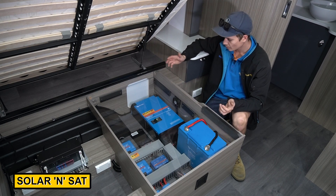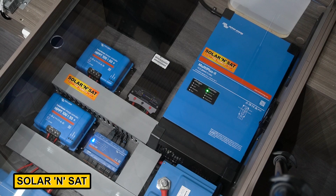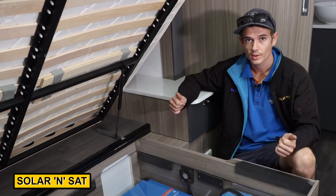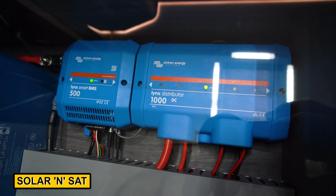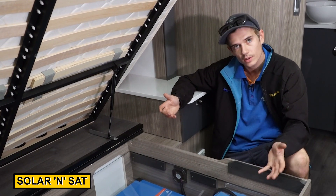With this one here it's really flowed perfectly. We've managed to fit the 3000 watt Victron inverter on this side with a fan above it, so it still has plenty of ventilation. We've got two 100-50 solar regulators to handle the solar on the roof. We've used a 50 amp Victron DC to DC buck boost that'll handle the charge from the vehicle's alternator all the way back to the caravan's battery. We've got a big 330 amp hour Victron lithium battery that can handle a massive discharge of 400 amps. We've also used the Lynx Smart BMS with the Cerbo GX, and added a Lynx distributor to make the system flow and work neater — that's all our fuses. If a fuse pops, a red light will come on so you know instantly.